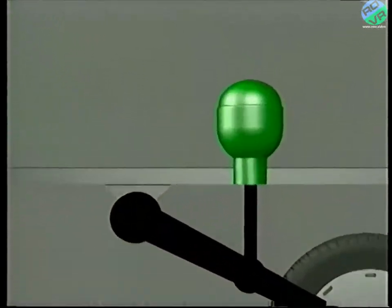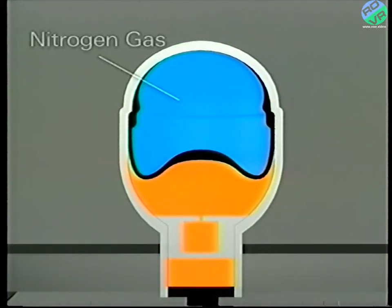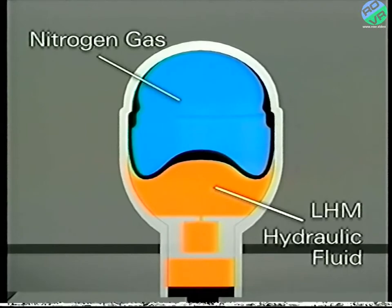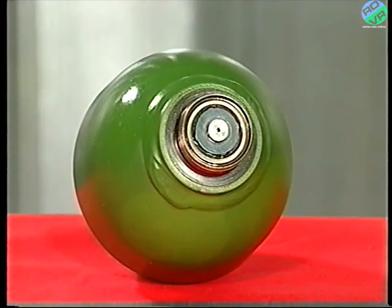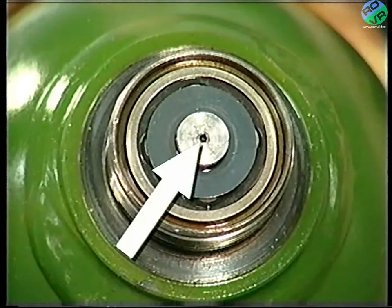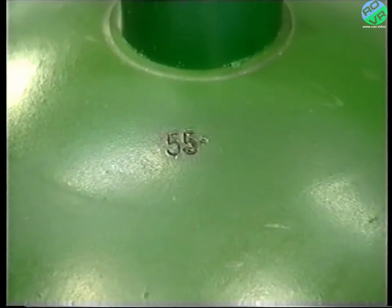The previous videos showed that the steel spheres contained a flexible synthetic diaphragm, on one side of which is nitrogen gas, and on the other is LHM fluid. Unlike an accumulator, each of the four suspension spheres include a damper. It's worth noting that there are a variety of suspension spheres for each model. The size of the damper's drilling and the bump and rebound characteristics can all vary with the vehicle specification. Furthermore, the volume of the sphere, the diaphragm material, and the gas pressure can also differ.